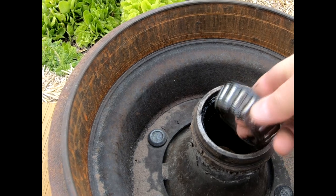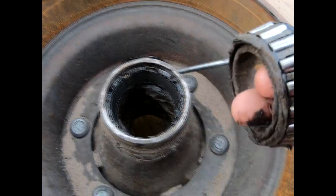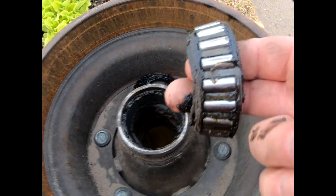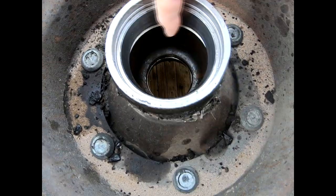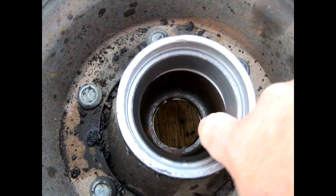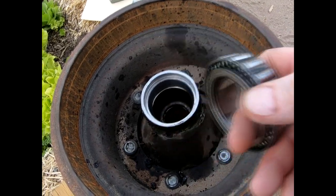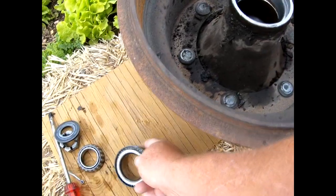Check that bearing and make sure it's okay. It's greased but it sounds terrible — I'll clean it up and have a look. I'm sure it'll be fine. Then I'll clean the front race, get this hub cleaned up, get some fresh grease in there. A little parts cleaner and a nylon brush to scrub out the bearing race inside the hub. The inner bearing is okay — races look okay. There's only one reason you'd leave old grease in there and that's because you're lazy.